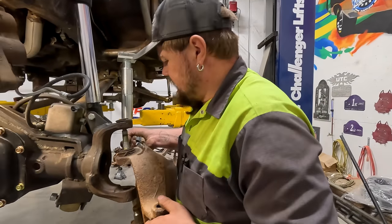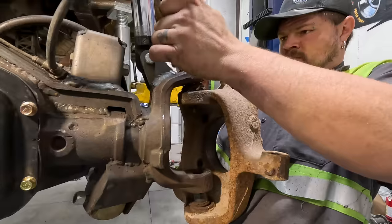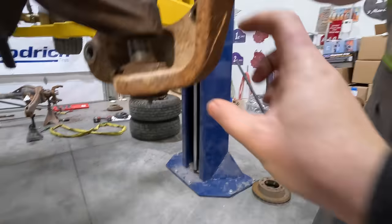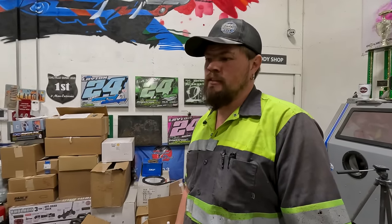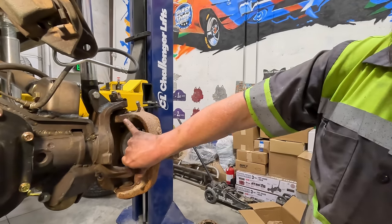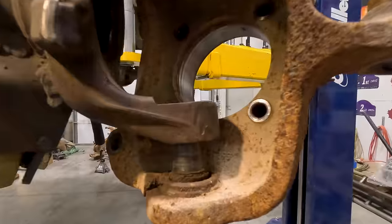Moment of truth to see if my research done me good. That's going to bottom out — they're way longer. See, this is a lot lower — look how much more from this knuckle is there. Compared to here, it's way shorter. This sucks — sucks very badly. But now we know. I didn't type in any years and didn't say anything about the years, so that might just be the difference from the 90s Dana 60 and the 08s — the Dana 60 is wider on the 08s.